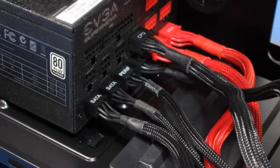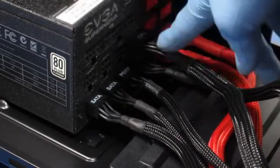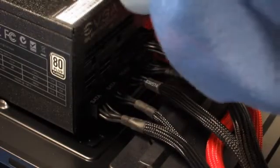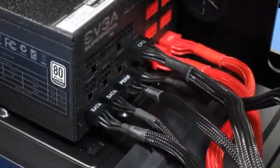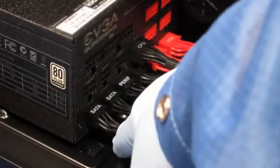So we've installed cables into the power supply. The red ones are for the GPU and they'll go to the graphics card, and we have two cables for the CPU. We have a peripheral cable that has the Molex connector on the end, and that will go to the power connector at the bottom of the motherboard. The two power ones go at the top of the motherboard — there's one at my fingertip and the other behind the heatsink. There are also two SATA cables and I put them toward the bottom to make things easier to route.